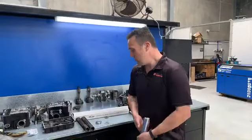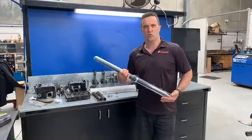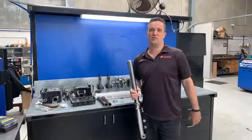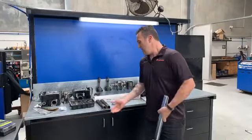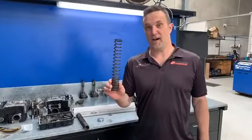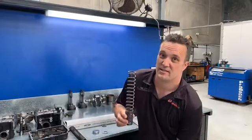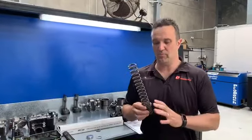But look, real quick one, something comes up all the time. People don't understand it. You're not going to get it in a normal everyday service shop. I've been racing bikes all my life and I've worked for the best riders in the world in suspension and race tuning shocks. So a thing that comes up is this business. Get it out of your head, it's just marketing. There's no such thing as a progressive spring that works properly. And anyone that says it, it's just a word that's used in internet and marketing, oh, progressive.